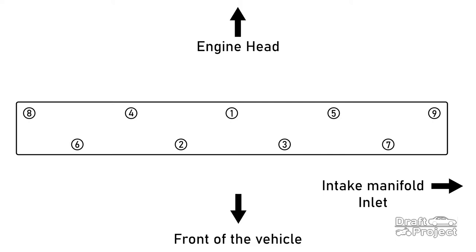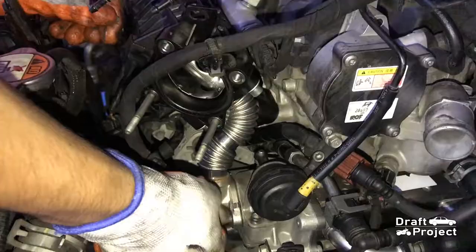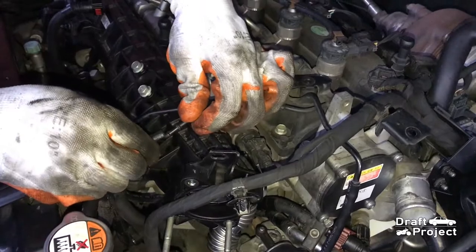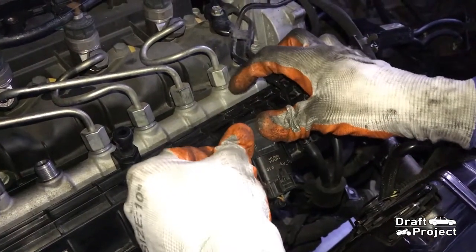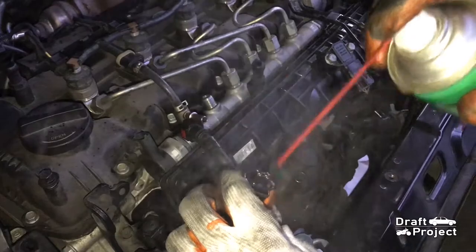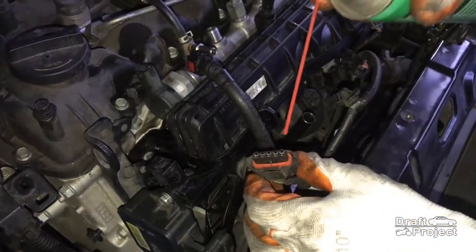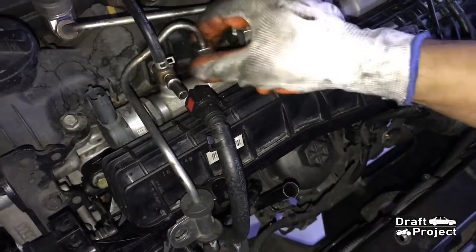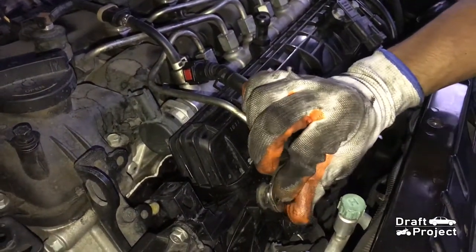I don't have a service manual for this vehicle, so I couldn't provide any torque specs. Reinstall the two 10mm bolts underneath the intake manifold. Reinstall the bolt for the tube that connects to the EGR and tighten it snug. Connect those two vacuum lines and reinstall the bolt back onto the bracket. Reinstall the MAP sensor along with its two 10mm bolts. Clean every electrical connector and make sure they are completely dry before you connect them. Reinstall the main fuel line and make sure to tighten it. Press the plastic lock while inserting it and make sure it is secured. Put the nut back onto the main fuel line holder.